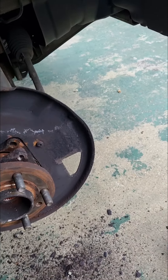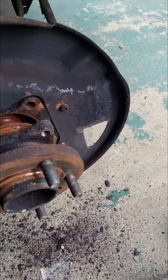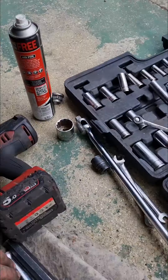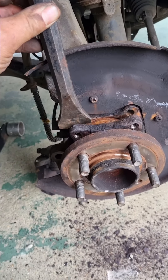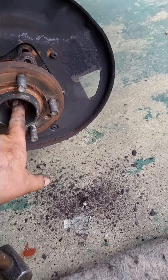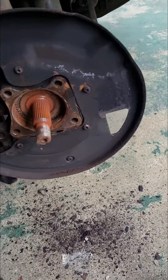So full left lock — steering right over — a few taps on there. If you can't get it out easily but you can see it's starting to move, I've got a big chisel. Drop the chisel down in behind it until it's moving a bit further. Put a bar on the end of the drive shaft and give it a few taps to make sure it wasn't seized — and eventually she comes off.